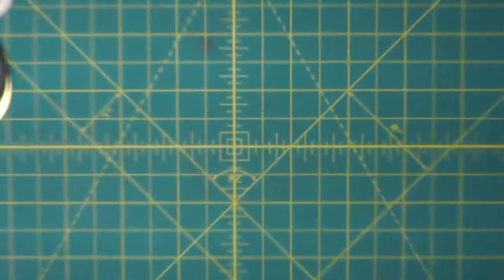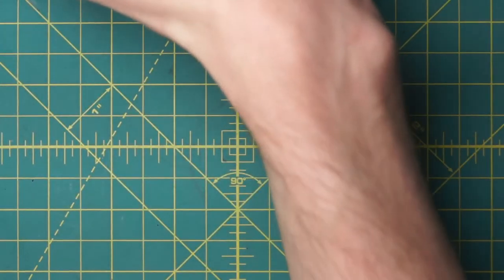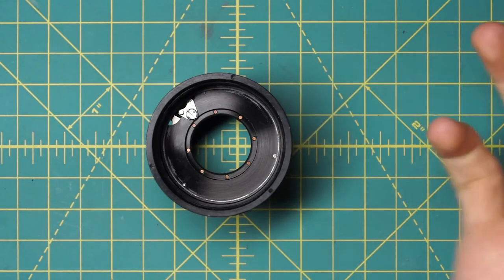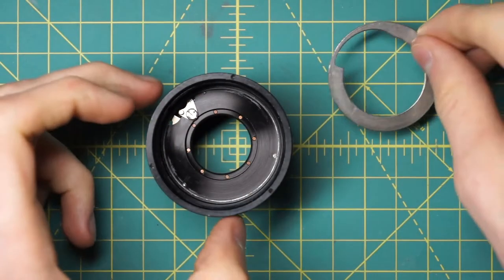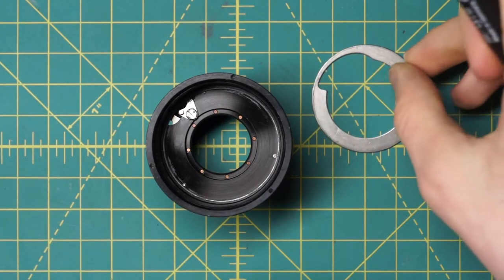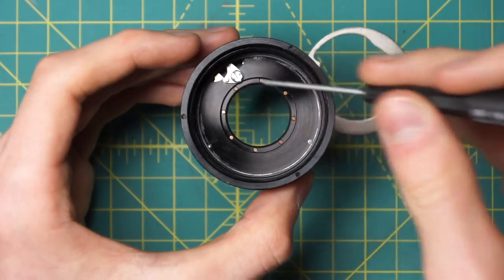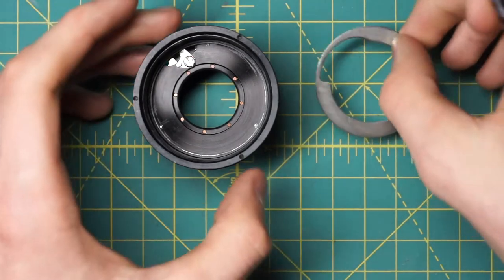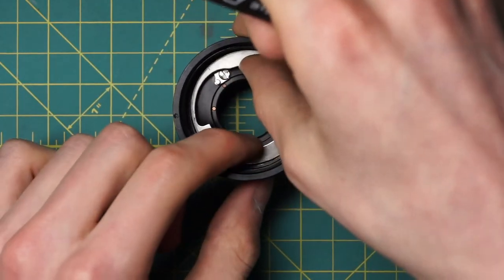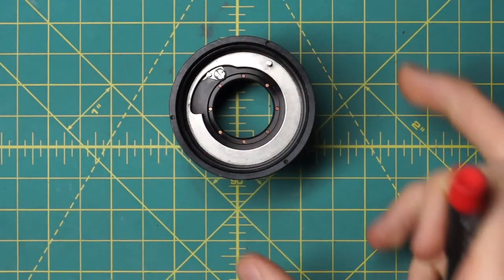Putting the lens back together, the real challenge is getting the optics back in place cleanly. We'll start with the diaphragm itself and reassemble the mechanical components on the front section. First, there's this silver ring that has a gap or cutout and a curved section — the aperture control curve. As this silver ring rotates back and forth, the little post inside moves up and down along that curve. We'll pop the post out closest to the center and put the ring back on top of the aperture control ring.